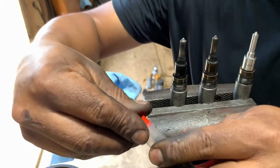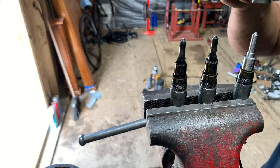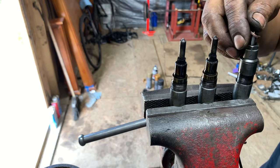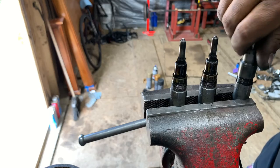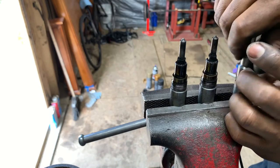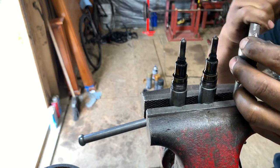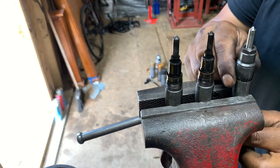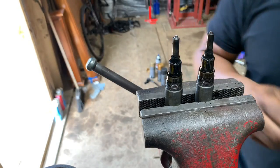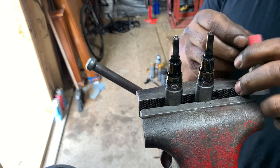So this you can just close, stay there, the old one. Now you blow a little bit and put the copper washer. You can reuse the old one. I'm gonna show you what I do to reuse the old one. So try to tighten this one so it doesn't stay open while you're here. So making sure it's tight. So this one is done. And I'm gonna show you in a little bit how I do the washer, the copper washer.